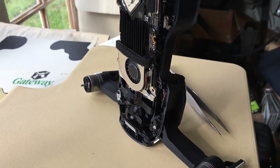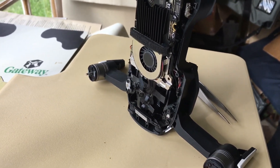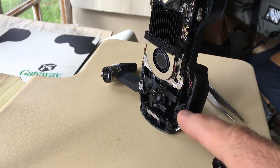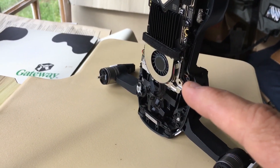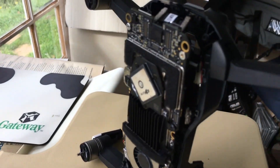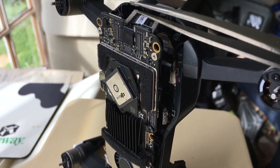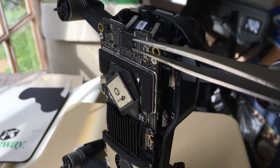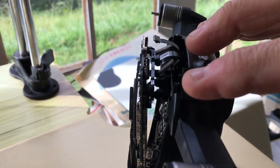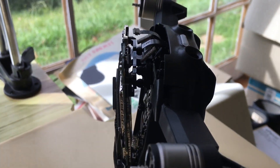I'm trying to avoid pulling the entire thing apart like the video I saw on the web, where he pulled off the gimbal, all the actual camera, the CPU fan, everything. I'm trying to avoid that. So I've just disconnected a few ribbon cables — a little ribbon cable from here and the triple ribbon cable arrangement at the back — to get enough leverage to avoid pulling the whole board out so I can just get the IMU. That's all I want to replace.